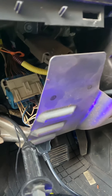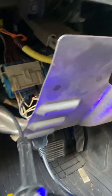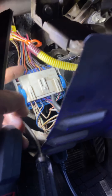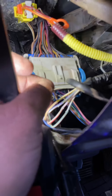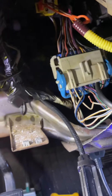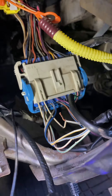I already diagnosed this, but I thought it'd be interesting to share it. This cable from the ignition switch — it's an orange one, that one right there — is supposed to have battery power. Another electric guy had got this truck prior to all this, and he's the one who cut this wire and put a power wire, which is this one right here, and he just bypassed this, adding power to the ignition switch, and got the truck to turn on.